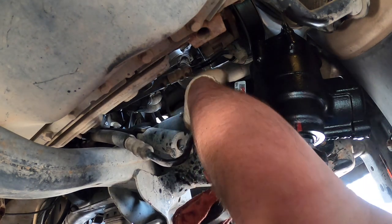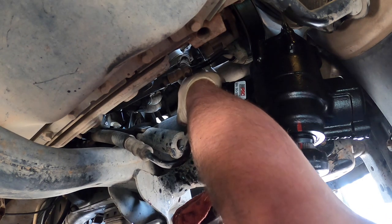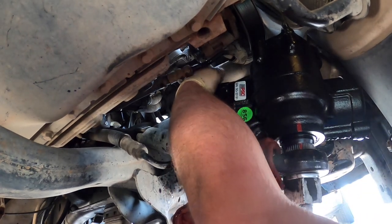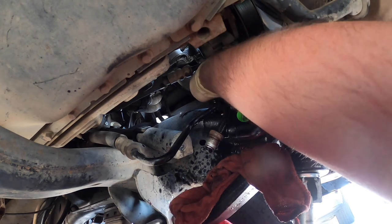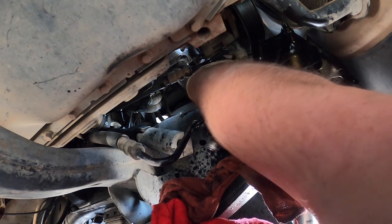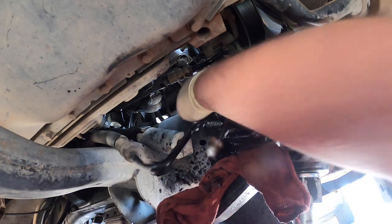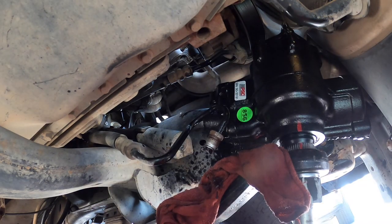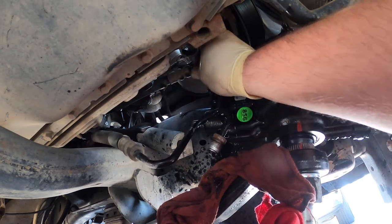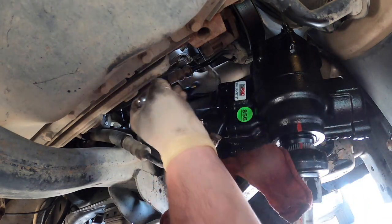Okay. Now these caps I told you to loosen earlier. This is why you do that. You take them out right by hand. And if they're plugs, I usually just take them out because they'll fight you. And it gets rough trying to pick them out when they're stuck in there. And it's just no fun. But see, you learn something new every day. I don't know how many of these steering boxes I've done, and I've never seen different length bolts, but I did kind of notice that the frame was a different depth on the bolt towards the inside of the vehicle.